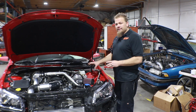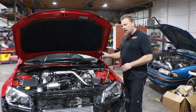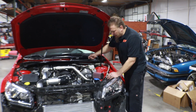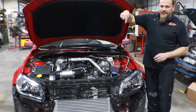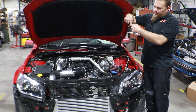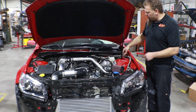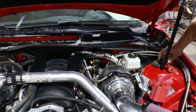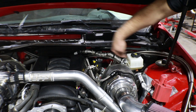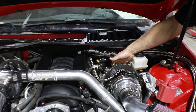The next thing we're going to do is actually the power wire here. This is the main power coming from the battery in the trunk. This has changed slightly — it's actually protruding out right through the firewall on the SS here, and it's actually a plastic bracket that points it down. So what we're going to do is use a pry bar and twist it like this so it actually shoots more out towards the driver's side outside of the car. That's going to shoot the power wire off to the side so we're not pushing it right into the downpipe, giving us a little bit more clearance room.